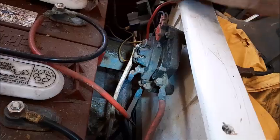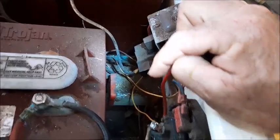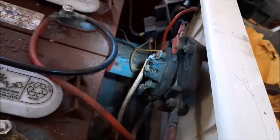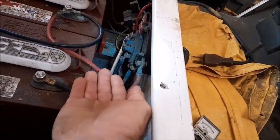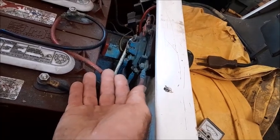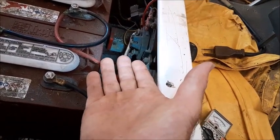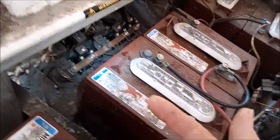The accelerator box that has the micro switches is located in this box right here, which is underneath the driver's seat. There's actually a lever that when you push the pedal down it engages these micro switches. If you stick your hand up underneath the micro switch box you can actually feel that lever moving back and forth just to make sure it's actually in operation. Sometimes by reaching your hand up underneath there and jiggling that lever it will actually engage more of the speeds on these solenoids.